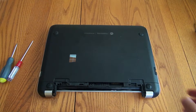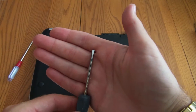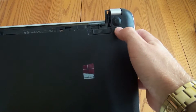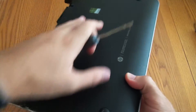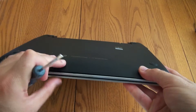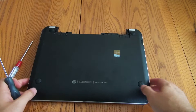The battery might look a little bit different if you have one of the extended ones. For the next part, this is where you're going to need the small flat head screwdriver. Basically, if you look around the laptop there's a plastic seam that runs all the way around, and you're basically just going to pry up that plastic piece and it just pops right off and gives you access to the inside.